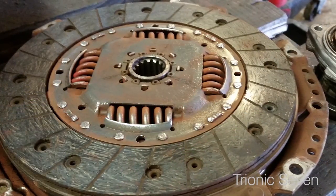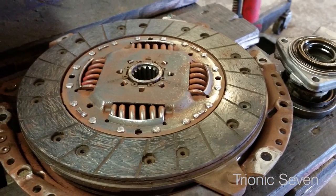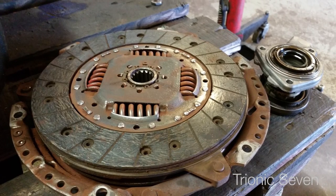That bolt had caused so much damage. Here's a picture of the whole clutch assembly, slave cylinder, and throwout bearing. The technician told me the clutch itself was completely gone, the pressure plate was worn out too, and the slave cylinder — I could move the whole cylinder and bearing a few centimeters up and down and wiggle it around. But I'm happy for the car now. It's running really well — we put in a new clutch, the Aero clutch, with a new pressure plate and new clutch assembly.